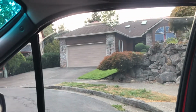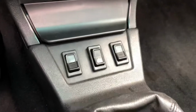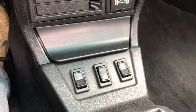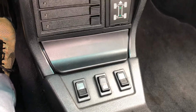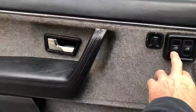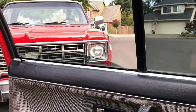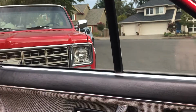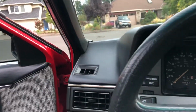Power windows in the rear need switches replaced. They need the rear door mounted switches, and the console mounted switches here replaced. These are the rear doors' front controls. Apply power to the motor, they work just fine. I pulled the door panels off and tested it, but never got around to replacing switches. Too many other projects going on, but our other windows work. You can hear the regulators making a little bit of noise, but I wasn't going to replace them until it becomes a problem.